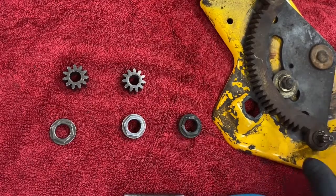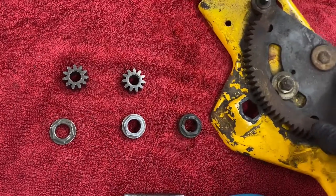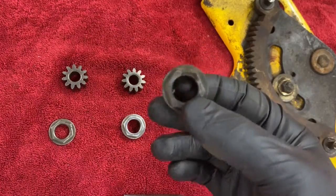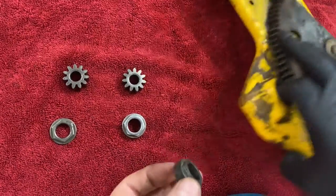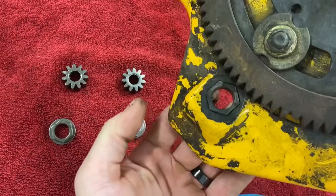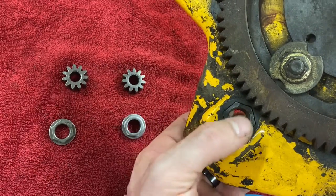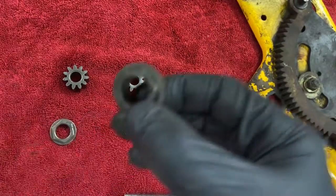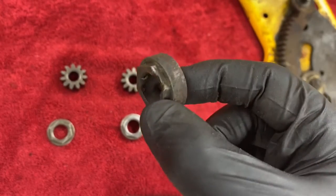We're at the shop table here, and you can see we've got the steering gear off. I've pulled out the problem child — this is the actual bushing. The way it works is that this bushing slides up in here, and the steering shaft slides through there. What happens is this bushing wears out and starts flexing. This one in particular is missing a chunk right there, so that was causing some of the flex — they just get worn out on the inside.